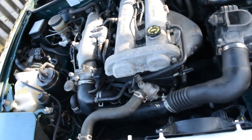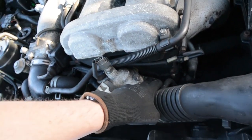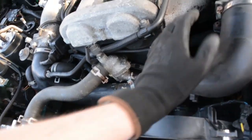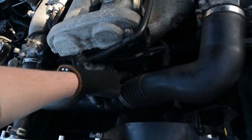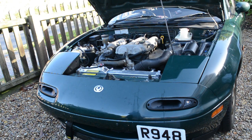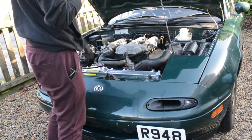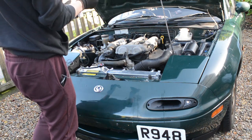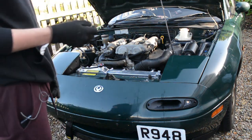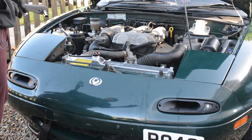The problem we've been having with the alternator belt is basically that it's sticking or slipping, so I can't quite get the right tension. What we're going to do is take off the alternator belt by loosening off the bolts — we might need to take off the induction pipe to get to it. We're going to loosen everything off, make sure the alternator is nice and loose so I can slip the old belt off, then use some brake cleaner to get rid of any rubber residue. I'm going to be using a 14mm socket, 14mm wrench, and a 12mm wrench as well.